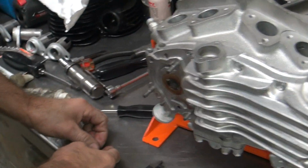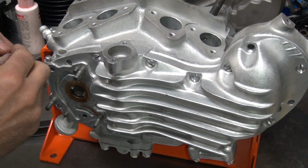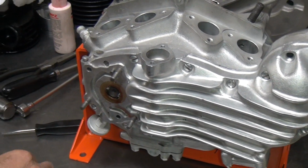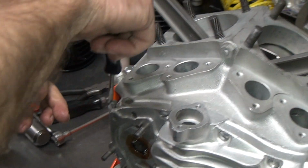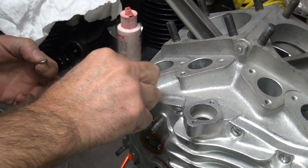The fine adjustment will be done while the bike is running, huh? You take out shims or add shims as needed. The problem is these shims are not available for anybody. So if you have them, you've got them. So you buy an old cover to get the screw out that has a shim with it. Wow. That's where they come from.